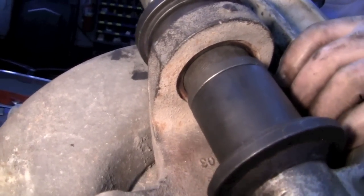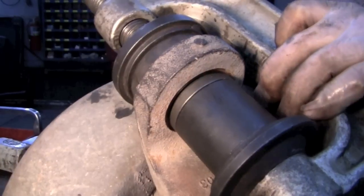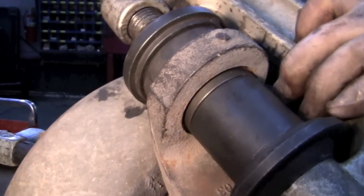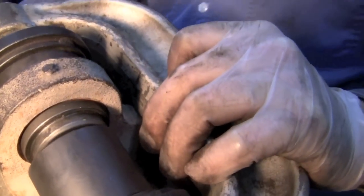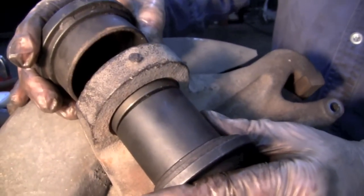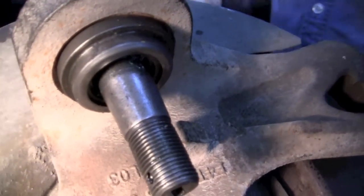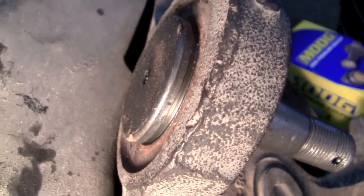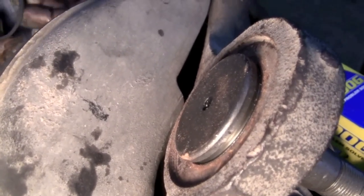We're going to try to drive that ball joint up in place. Now, how do you know that you're actually in tight and far enough? Well, the first thing is the impact will stop moving. Take your spacers off and then you can look at the ball joint. The important thing to look at is on this side you can see the notch where your snap ring has to go. If that notch is not far enough for your snap ring to fit, you'll have to actually press it in a little bit more. But all you need is enough for your snap ring to go in place.